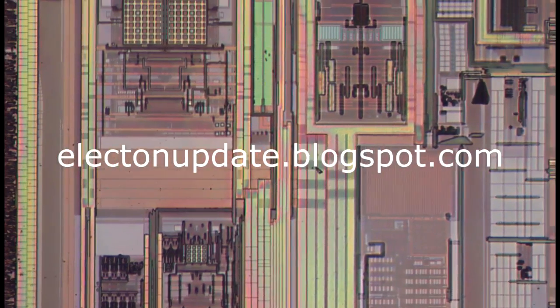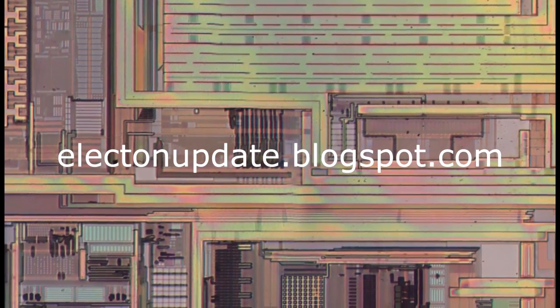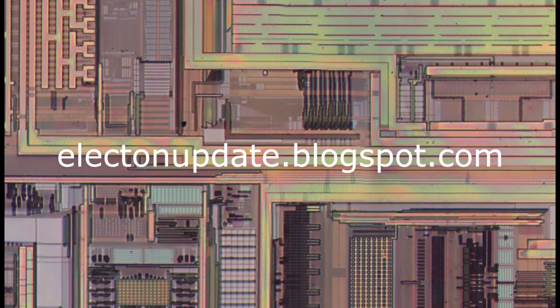There are at least two more parts to analyze. This is the third largest part in the assembly — lots of metallization obscuring the blocks below, giving a strong suspicion it's primarily a digital function. Then the main control IC is also very much metallized all over with just a few features sticking out. You'd have to strip the top metal to look further. This looks like a classic high-integration ASIC doing most of the actual work in the set-top box in the digital domain. There's just a sample of the integrated circuits I found on this old set-top box. The dies are posted on my blog as large stitched microscope photographs, so you can see the real difference between a pure digital function and an RF IC and how they are quite obviously visually different at the top level.